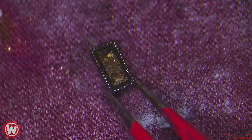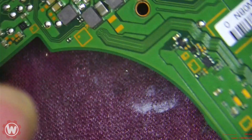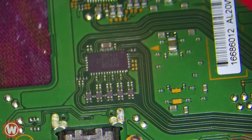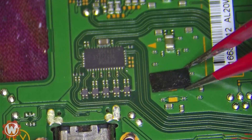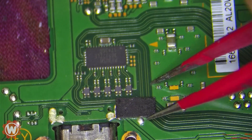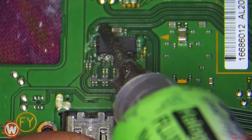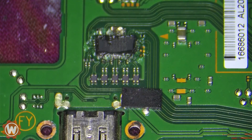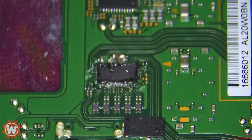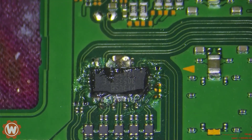We're going to bring the board in and put the pre-tinned chip right next to it so we can easily swap it out. We'll apply some flux on the original chip. 95% of the time, replacing this chip will fix the docking issue. We're going to replace it. Unfortunately we don't have a camera set up to test it in front of you, but I'm confident it will work.